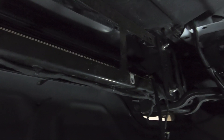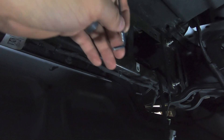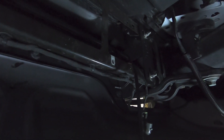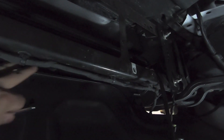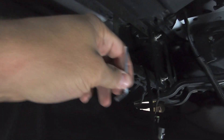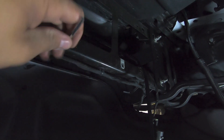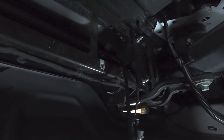I'm going to tighten down the brackets first — these two bolts here, then these two bolts — and then I'll go back in and tighten down the light bar itself. The light bar is going to be a little tricky. I'm going to end up having to use an Allen wrench because it is pretty close confines in there. I'm probably going to have arthritis coming out of that one, but this is the only way to get access there without removing the front of the grill. I don't see any other way to get access to the side of the light bar to tighten it down. We're going to use an Allen head — it's small enough, compact enough. It might take an eighth of a turn at a time, but ultimately we'll get there.